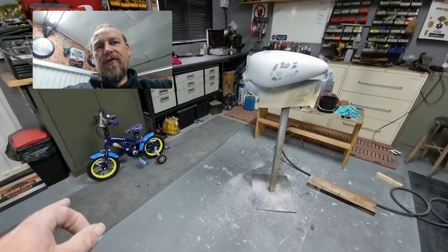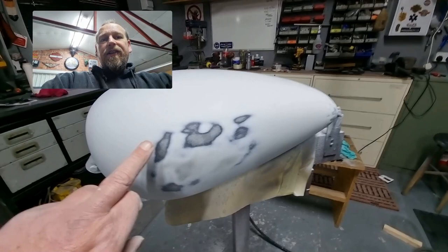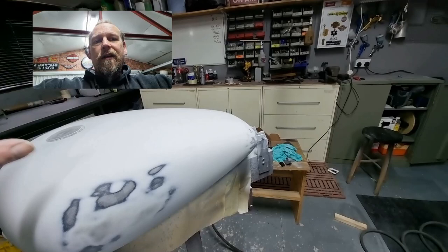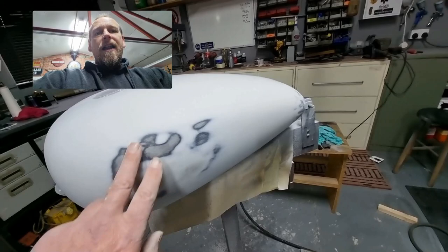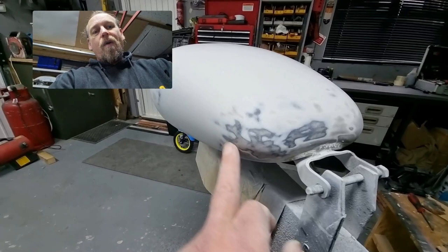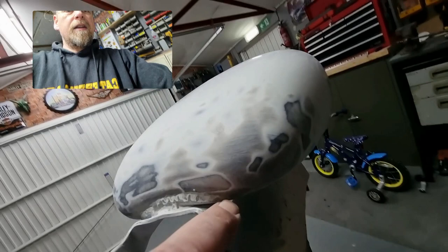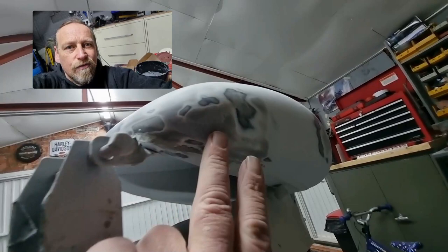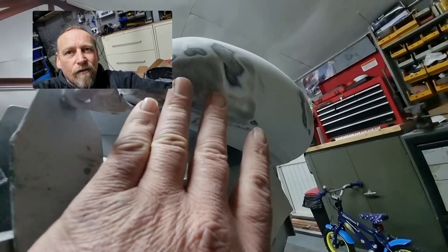As you can see here, this is where we had a few of the indents. You can see where we laid the black dust coat on and sanded that down to show the detents in the tank, which showed here and here — a little bit of grey where the filler has covered. Now this is nice and flat. On the front as well there were quite a lot of little detents which we have tucked down now, and you can see the filler under here which we've sanded down around the weld joint. You can see how much work we've had to do to get these out. Never presume it's perfect, because these would certainly have shown through the top coats and clear coats when the tank was finished.